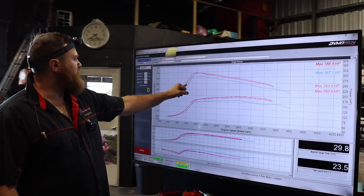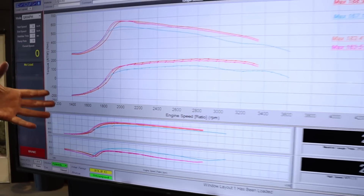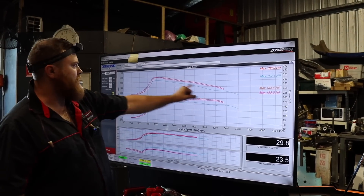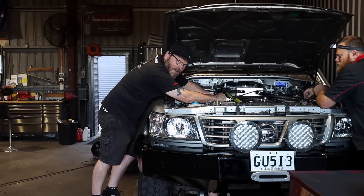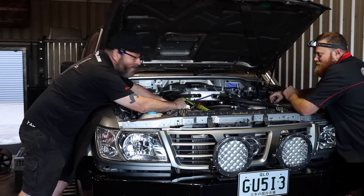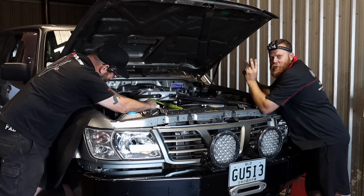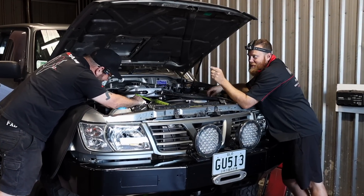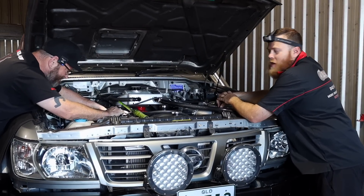Pulling some timing out — we can see it's actually come up on boost a little bit quicker and boost is higher on those two runs back to back. Basically because the timing's more retarded, more energy's going out the exhaust valve to drive the turbo, so it's responding a little bit better down low. But we're pretty much losing power virtually the entire way across the curve — so we did not make the right choice. We're going to start tweaking that timing back forward and see where it's happy. People come in all the time thinking more timing is always better — doesn't always happen that way. Usually it sounds like there's milk bottles rattling around in the combustion chamber. As we pull timing back, the torque curve comes back and makes more and more torque. This thing was honestly pretty damn close — we're just going back to where we were.